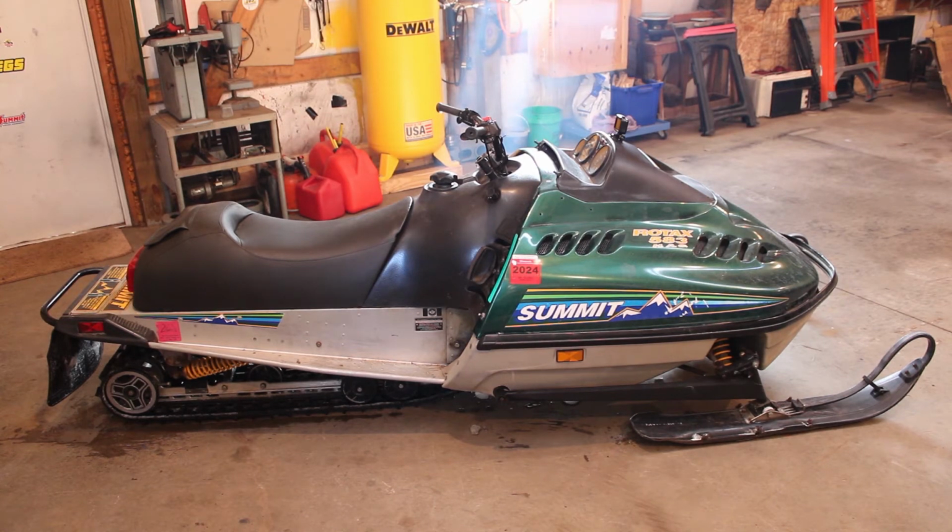I mean, when it was invented back in the 90s and what they used it for, and it stands for high altitude compensation. I'm sure most of you probably know that, and it's really just a mechanical device to change your air-fuel mixture based on altitude. So when you head up into the mountains with your 2,000-pound Summit, you don't have to worry about rejetting and stuff like that, and you can just spend all of your time digging it out of a snowbank. But down here at sea level, you really don't need it. I mean, we're not at sea level, we're like 700-some feet above sea level, I think. So regardless, still absolutely no reason to have that on there.